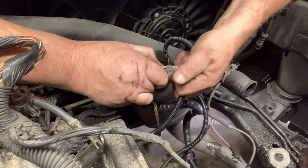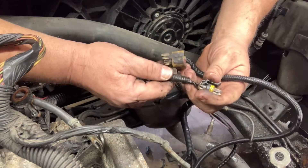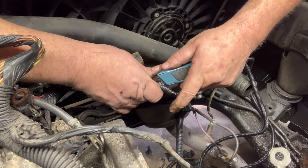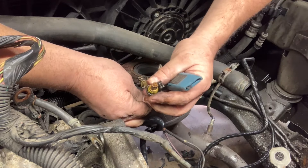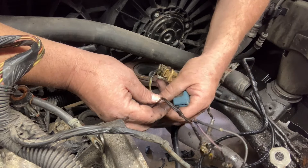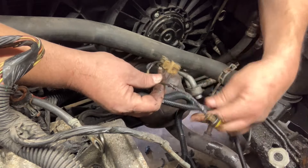This is my knock sensor — I need to take that out, it's still hanging on there. There, that'll make it easier to work with. We still have a piece of old aluminum stuck on that wire — we'll cut that out. I always like to look at the oil pressure sensor connectors; these have a tendency to go bad on the 3.5 and 3.9 engines. This one looks like it's still okay so I'm leaving it, but I have some brand-new ones I can replace it with if I need to. They're a pain in the butt to get to once you have the motor in, but you can get to them.